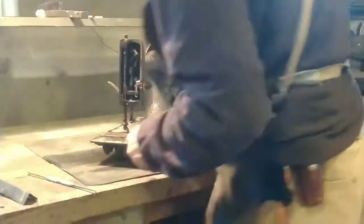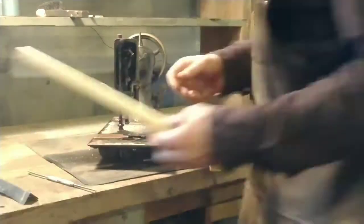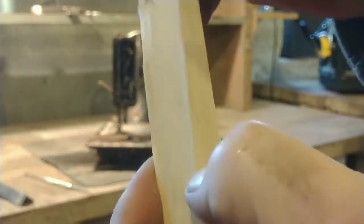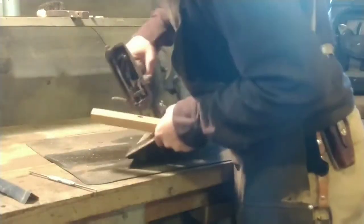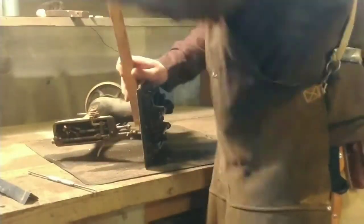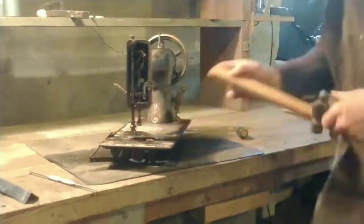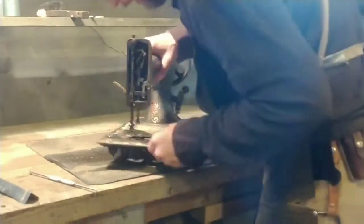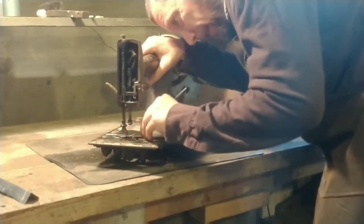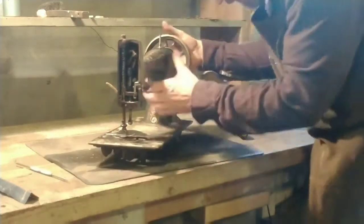I really like these shuttle machines, they're pretty interesting. I'll get a video of the shuttle going back and forth when it's finished. I went up to the shop and got a little piece of hardwood. I'm showing my thumbnail - see how easily it dents that piece. If you don't know the difference between softwood and hardwood, try it with your thumb. If it dents very easily it's most likely softwood. The rear bed plate was so stuck it was actually splitting the pine stick I was trying to drive it out with, so I got a piece of hardwood and drove it right out.